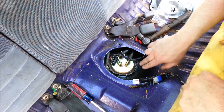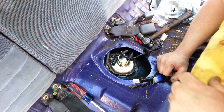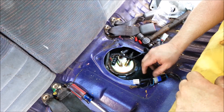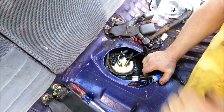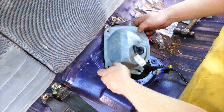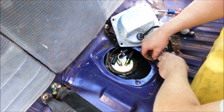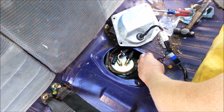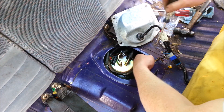Fuel pump is installed. Now is a good time to shake the tank — shake the car — and if your fuel level is high enough, gas will show a leak instantly. It's so thin that it'll just wick out wherever there's a leak. We're going to test it for leaks, but first let's screw down this grounding bolt, then reconnect the battery and see if we can get this thing to fire.